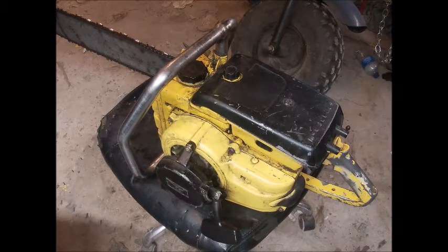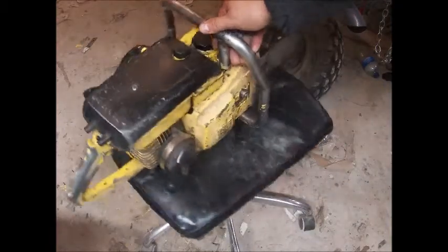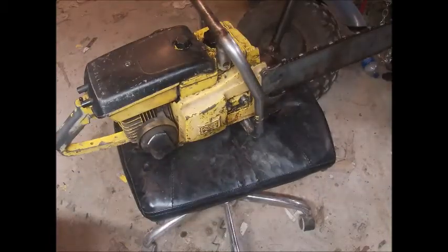Had one of those flatback carburetors. I actually still have that thing here. We put a Tillotson HL on it. I think I had to work on the starter cover. May have actually put one on it off of another saw. Full wrap handlebar. Has the big dogs. I put a CP directional muffler off of another saw on it.